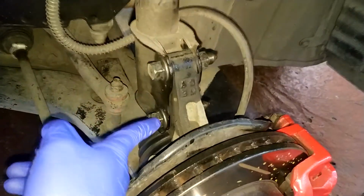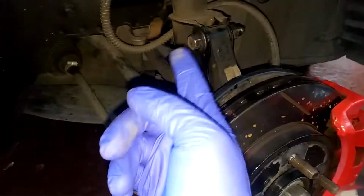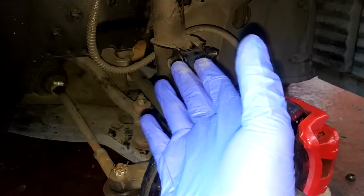So here before installation, I'm going to measure from here to here and put the same measurements on every single one of these coilovers, and then I'm going to put them in the car. So to take out the strut, you only need to take out this bracket right here, the bracket that is going to be in here. Then you only need to take out this bolt and this one, and then these three nuts, and that's it. As you know, I'm using just one hand to film and the other to show you, so I'm just going to show you how I'm gonna take out the strut.